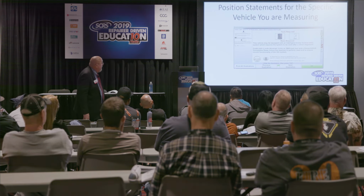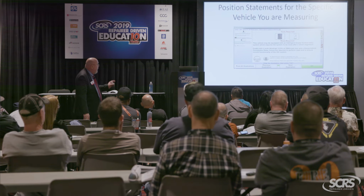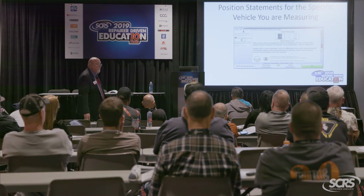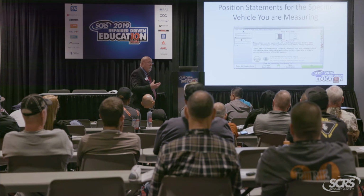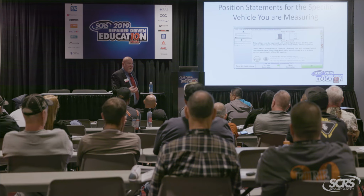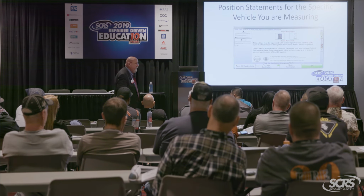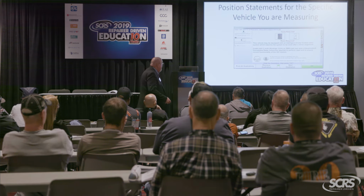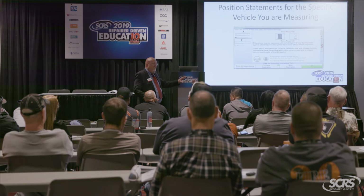What's it telling you? Well, in this case, I've got two resets that are required. I've got the reset for the steering angle sensor, and then I've got the reset for the wave sensor, which is a Robert Bosch wave sensor up underneath of the bumper cover that needs to have a static alignment performed with the alignment equipment, ADAS alignment, with the wheel alignment equipment. It has to be squared to the rear axle geometry. Okay, it's a very sensitive radar. Has to be aligned properly. All right, so right off the bat, because I've done this work, I can add this to the estimate. See how this is taking that pocket estimate to another level.